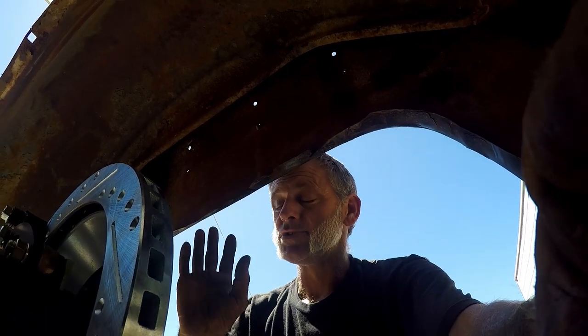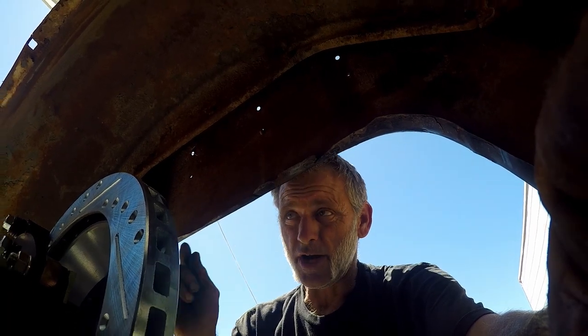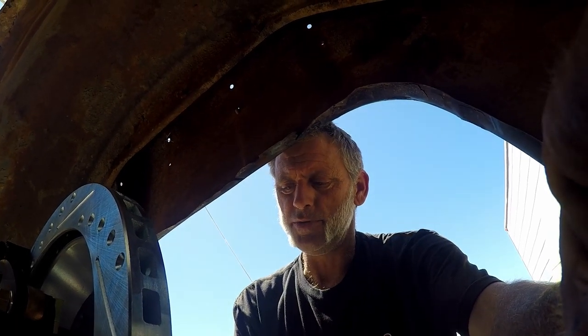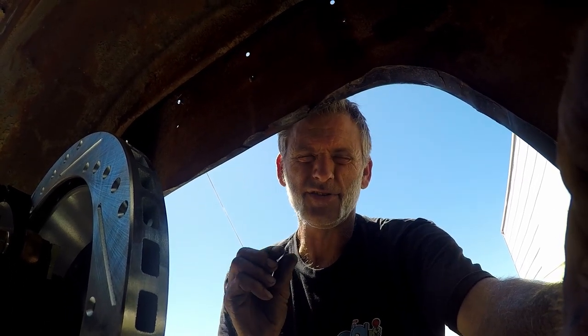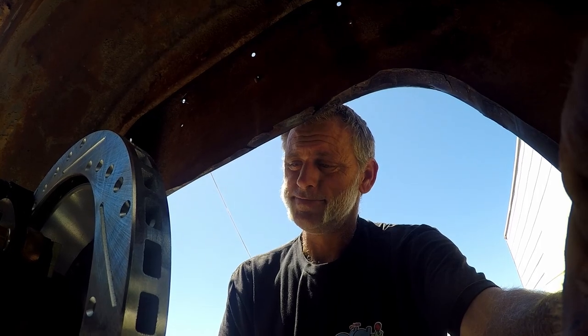Anyway, so now we got their saddle. Everybody wants to line up where it's at. So now I'm gonna go ahead and bolt up the other side. I won't bore you with that. And then it's probably prudent that we change these studs. We got another set of studs for this thing, and they're a little bit longer than an eighth inch, to allocate for the room for the rotor. So take the side back apart, bolt that side together, change the studs on both sides, and then I can bolt it all nice and tight again. So anyway, hang on, I'll be back.